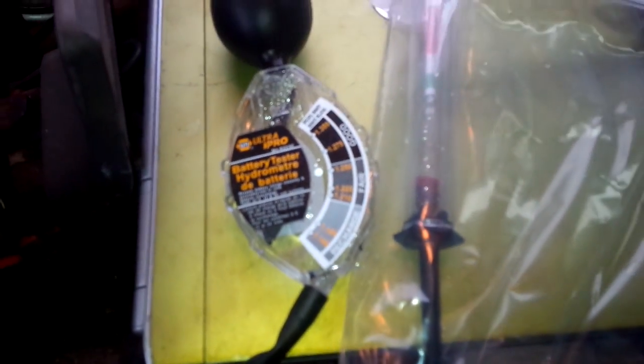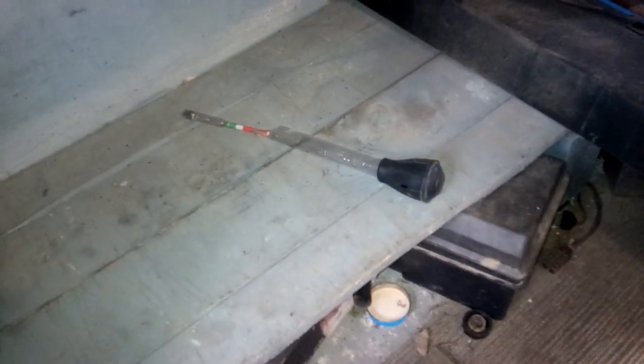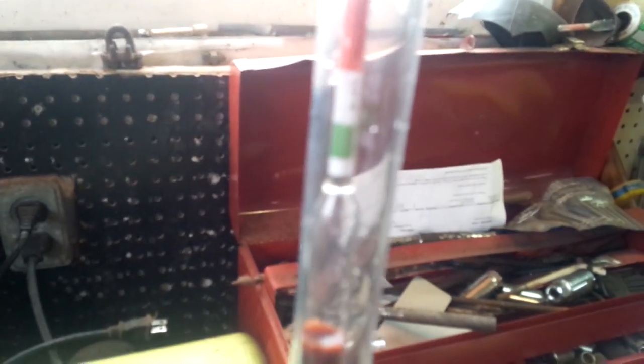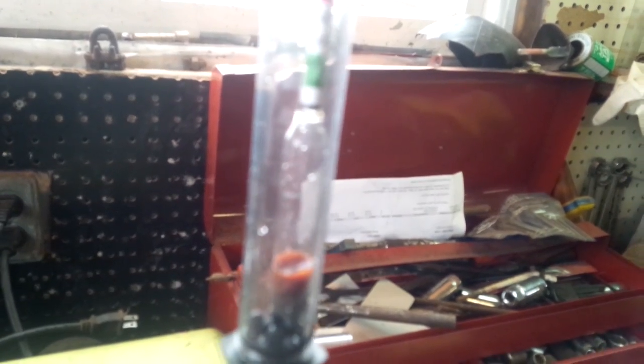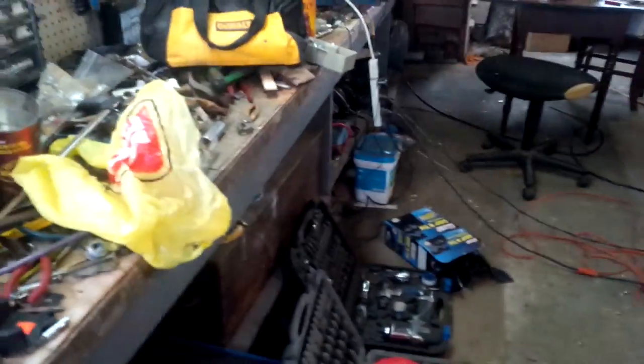I suggest not getting one of these — I bought this one in a pinch because I stepped on my last two regular-style ones. I plan on fixing it once I find a tube for it, but in the meantime I bought another one. This one makes it fairly easy: you have clear or red, white which is fair, and green which is good. The good range starts right around 1.260 to 1.265, which is what these batteries are at full charge.